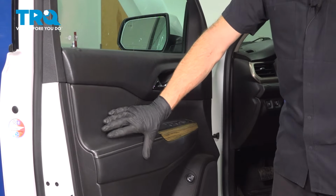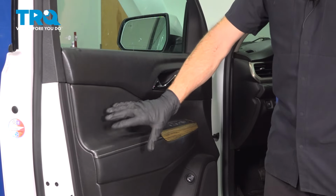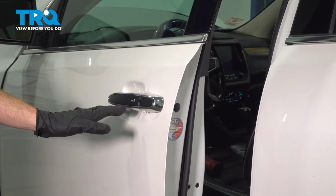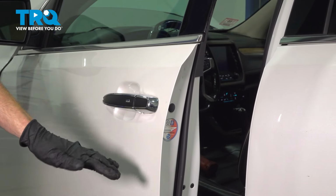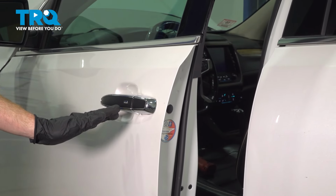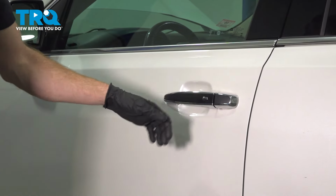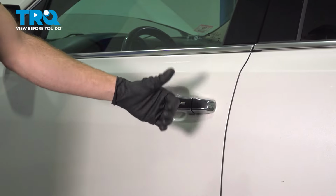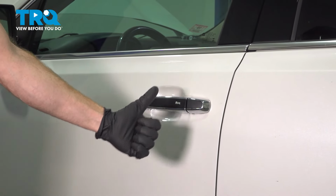At this point, the inside door panel is completely installed. The last thing we need to do is test the functionality. Let's test the functionality of our outside door handle one more time. We're making sure that the door is in the unlocked position. Go ahead and close the door. Let's give it a tug. Perfect. Thanks for watching.